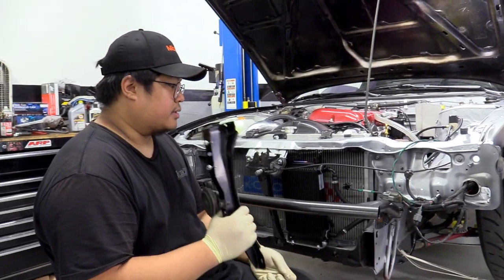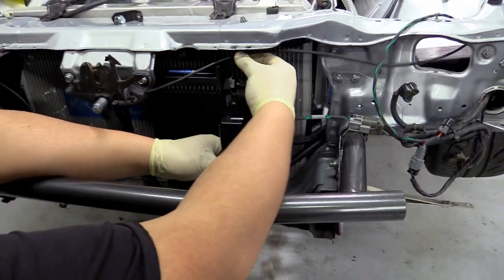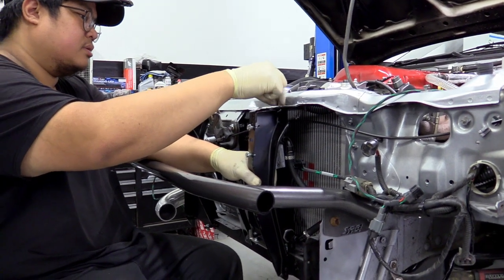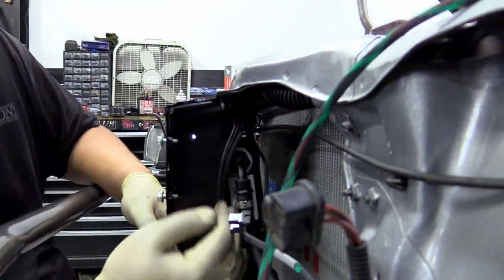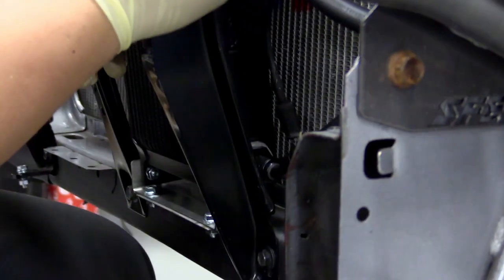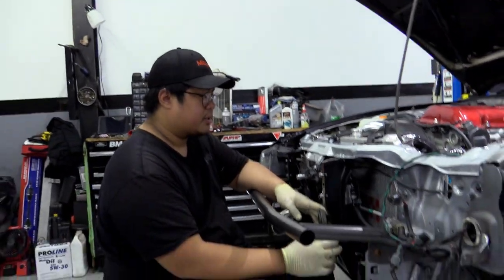That's it — the lines are tight. With a Silvia front end you'll have the tightest fit, but there is clearance. Tuck the hood release cable behind for now. You can see that with the bracket snugged up there's about an eighth of an inch clearance on the top or bottom. With a pop-up front end you'll have closer to a quarter to half inch clearance.